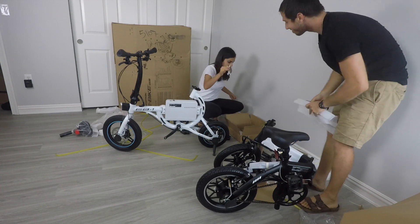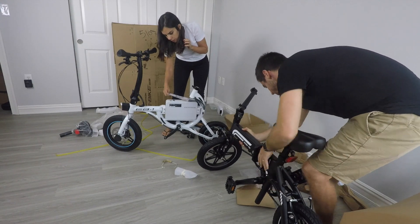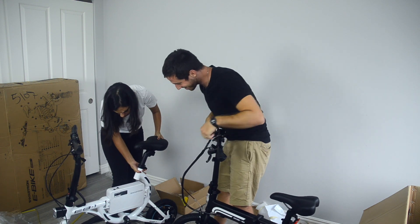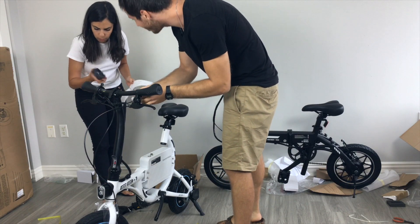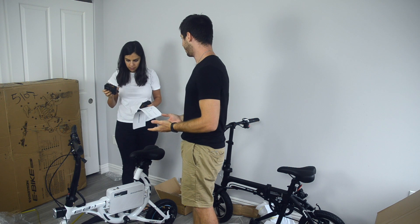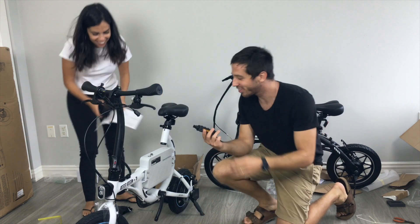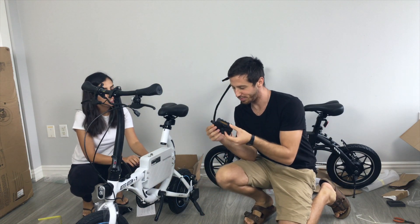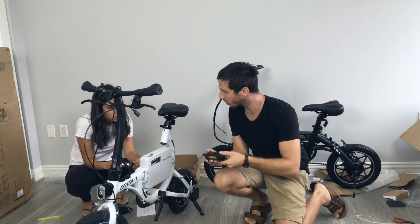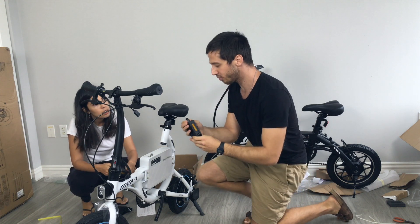They even give me the clip like Ikea. So it actually says left and right on the pedal. There's a trick to doing these pedals — the L goes on the left side, the R goes on the right side. The real trick is that one of these is backwards threaded, I think it's the left hand side. Basically you put each pedal on the correct side and then you turn them forward straight towards the front of the bike for both sides, and that way the one that's backwards threaded still gets tightened.